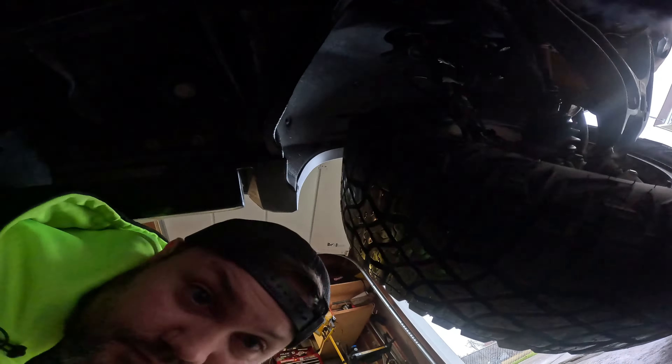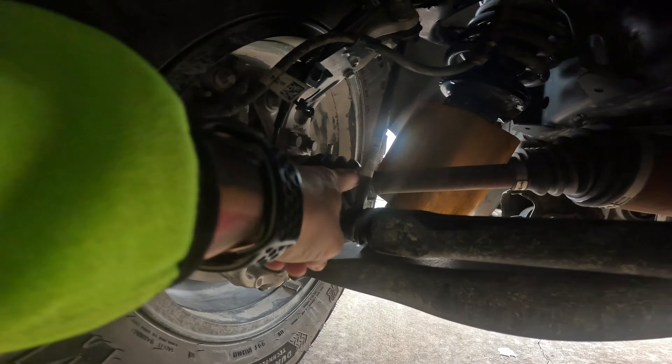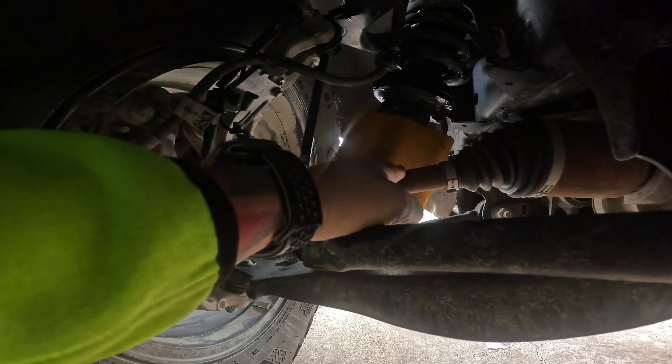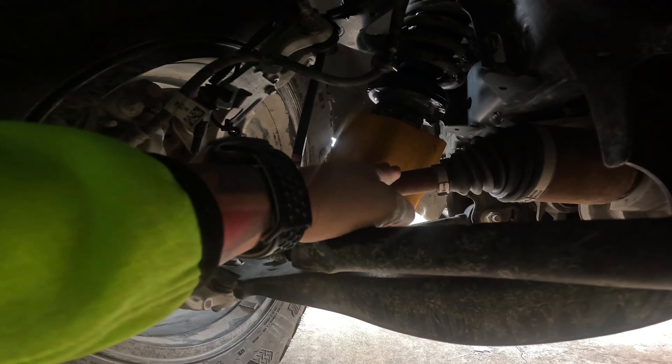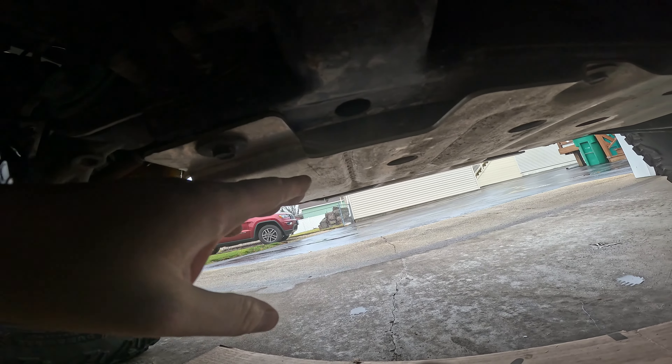Just a quick explanation — if you don't know what the diff drop is actually for, let me show you. This will be good while I haven't taken anything apart yet. You can see how the driveline is after we lifted it up — it's on a bad angle right here, kind of going up on one side and more down on the other. We're going to fix this driveline to put it back to where it's factory, so it's more level. That's going to keep it stronger. Basically you're just dropping the diff, which is right here, down an inch.